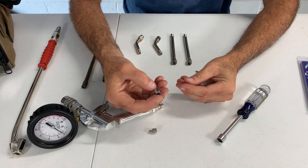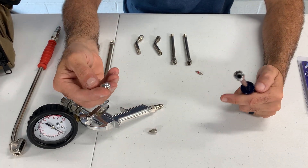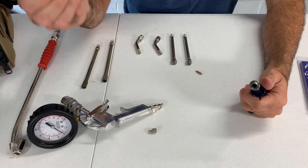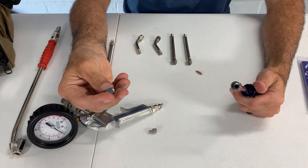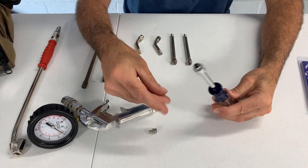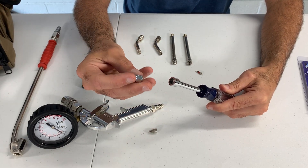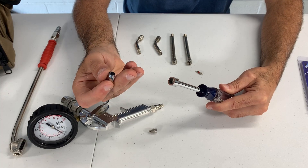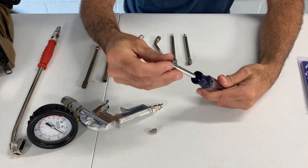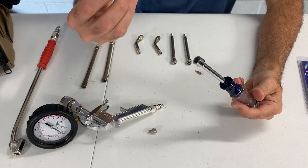What I'm doing now is basically just using the valve stem itself with the cap. The inner duallys are very difficult to get to, so what I've done is I carry around this nut driver, which happens to fit the valve stem cap. It's made out of aluminum. What I do is I put this on the valve stem cap and use the nut driver to screw down into the dually, then I can remove it and install it.